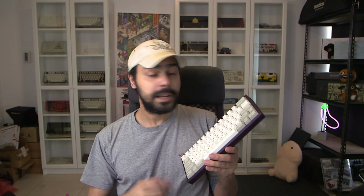You can rebuild it. For example, this Sandglass Ergo, which is a beautiful, big Ergo TKL. We built that a few weeks ago, and I noticed some of the stabs are not great. So tomorrow, on stream, I'm going to open it up, clean up the stabs, clean up the mounting points, all sorts of stuff like that. This Auger prototype that I'll be doing a review on soon was built with Owlab stabs, and they were so bad that we had to rebuild the entire keyboard. If I had tested the stabs, it wouldn't have been a problem.